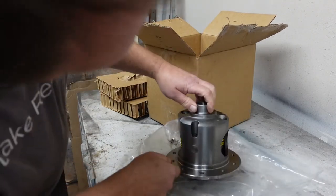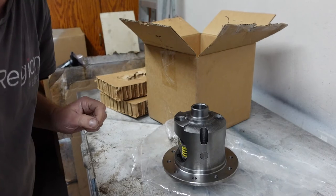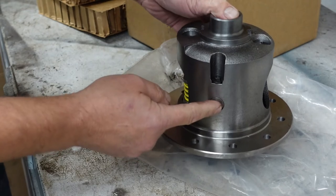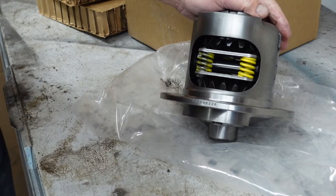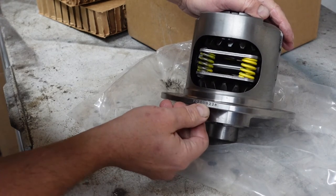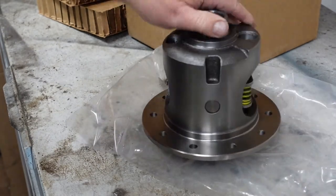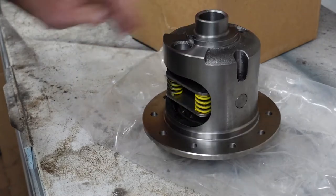Looks like I've got the center pin here and the bolt for it. I bet you can't even see down here — let me zoom in. So the other one had a bigger bolt, but this bolt really doesn't do much — it's a smaller bolt. But you've got the cross pin here and you've got your clutches for the limited slip. So it says POSI, POS GM8226. It was rated for 3.3 and up, and mine's a 3.36. And it is a 28 spline. So that should work perfectly.